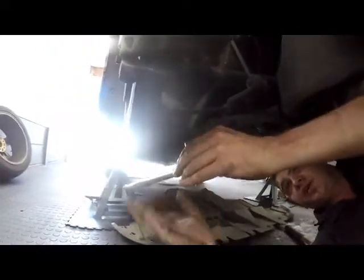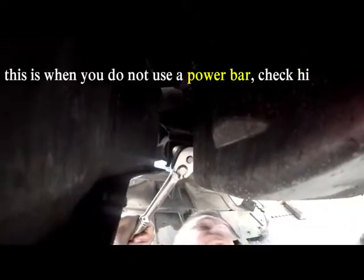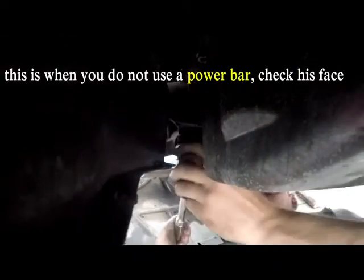Right, we're taking off the first, as we said, size 16s. And that's on the ball joint? Loosen them all off of the ball joint. All three of them, as we discussed earlier. Right, and here we go to the size 18 on the inside, same as what we did on the other side. A little bit of elbow grease, takes it loose, no questions asked. And now we go to the final, the back points up.